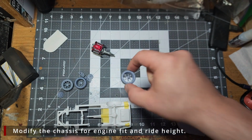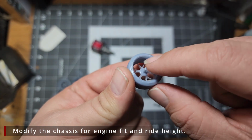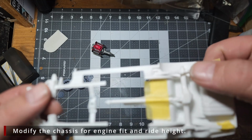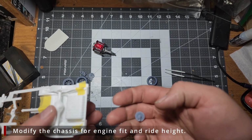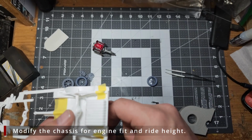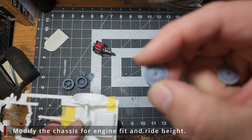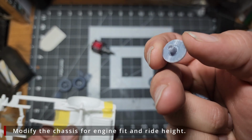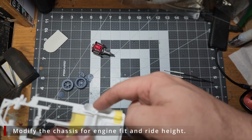what type of wheel am I using. Is it going to be a male fitment wheel or a female fitment wheel? I like to use the Tamiya style male fitment wheels. How is my chassis configured? Is it male or female? Am I going to have to convert it? So I have to design the spacer to have a hole in it for the Tamiya style wheels, and then have a hole that will go over the existing male style mounts on the axles.